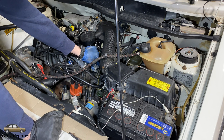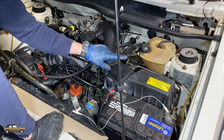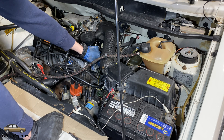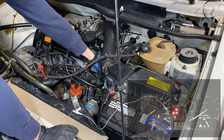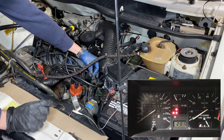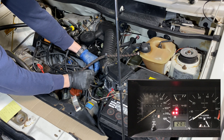The next part of this canister is this yellow wire right here, which is a low pressure switch to your vehicle. The way this works is you have power coming from the battery flowing into your instrument cluster and your oil pressure circuit. This yellow wire will effectively ground it out. So if the oil pressure is below 0.3 bar, the gauge is closed, effectively grounding out the circuit, making your oil pressure light blink as it is right now. If we unplug the wire, the light should stop blinking. If I now ground this sensor out, we should see that the oil pressure light is blinking again.